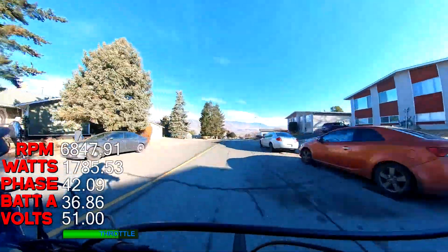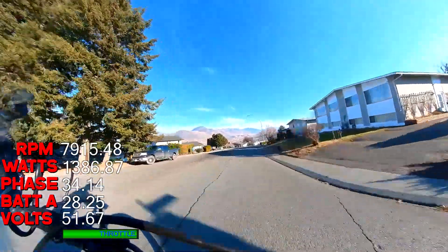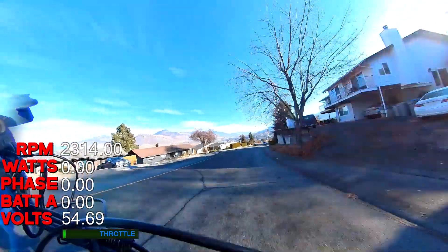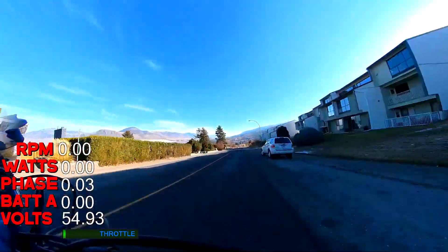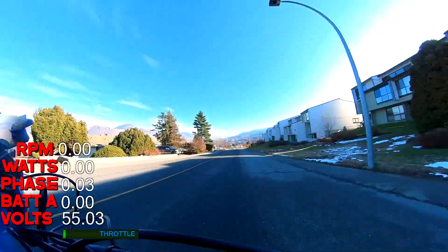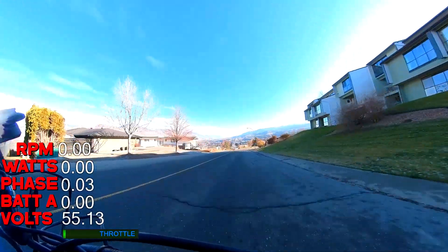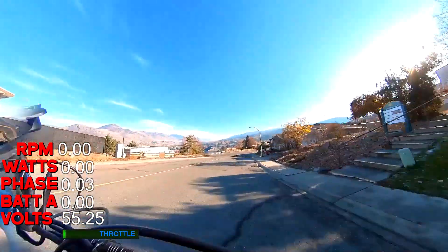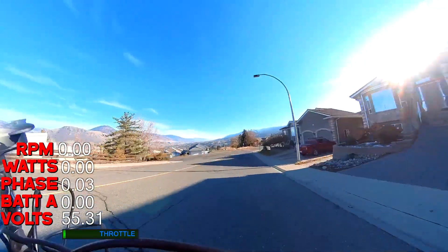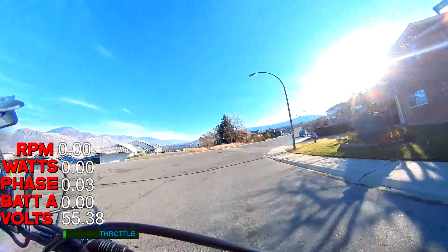It's peaking here at about 7000 RPM, just over — I think it might go up to about eight. Coming down the hill now, it's just over 8000 RPM, and that's only on 52 volts. Once we go up to 72 volts it's going to go a bit higher. I've also only got the field weakening set to 25 at the moment, so we're not near the peak — we can put it up to about 40 and extract some more RPM as well.